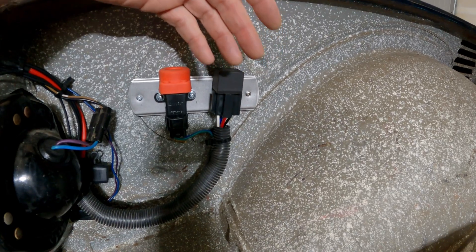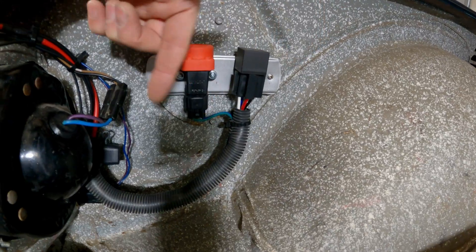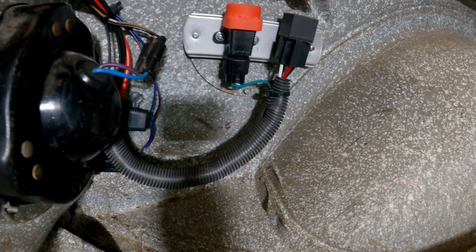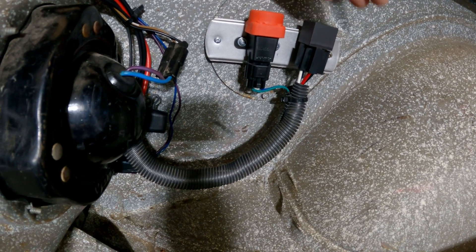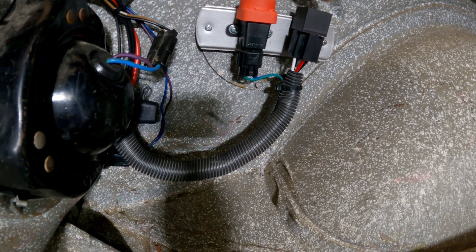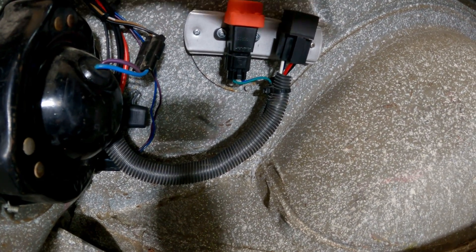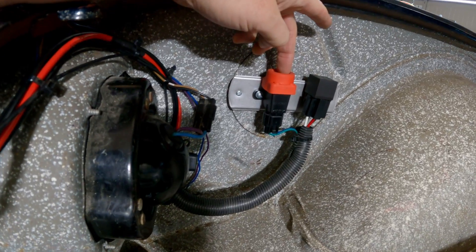I have a solid power line coming directly from the battery at the back of the car all the way to the front, to this relay, interrupted by an inline 10-amp fuse. It doesn't interact with any of the 60-year-old wiring, the fuse panel, or any of that — it's a completely standalone system, so I'm not relying on old brittle wiring and connections. This relay turns the system on and off.